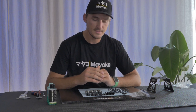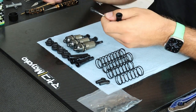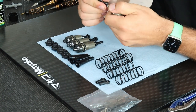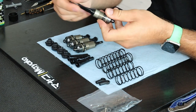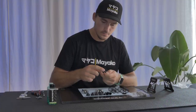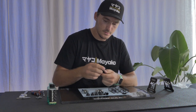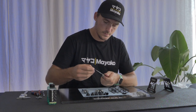The brown spring can prevent the rear from pitching up when you brake into the corner. But for this build and the base setting, I'm running black springs front and rear. To put the shock boots on, I take a little oil and put it on the side of the shock ends — that helps you slide them on easier. Then push them all the way up onto the aluminum piece and make sure they sit nicely. Same thing on the next one: a little shock oil on the shock end to help mount the boot.